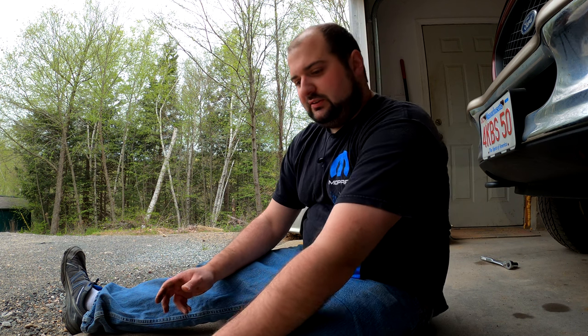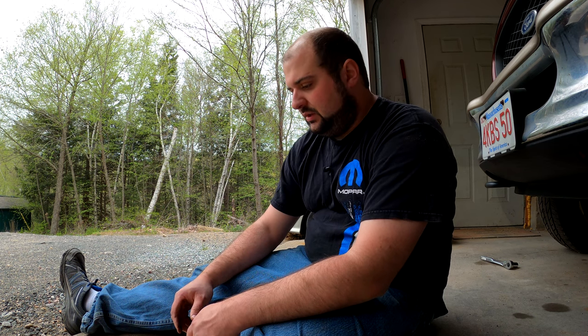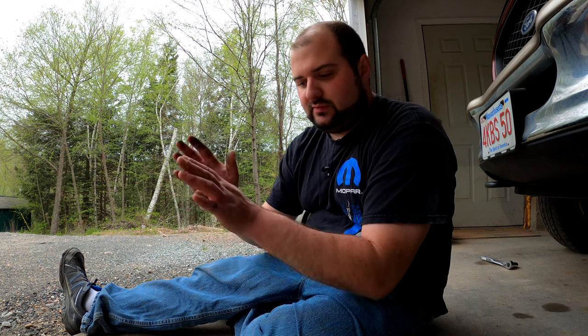When you buy a vehicle like this that's low mileage and has sat for a while, you're going to find that things like your bushings, your joints, that sort of thing — greases have dried out, rubber has dried out, things get cracked and brittle. You end up having to go through it even though it's got low mileage. This is one of the last pieces — this and the pitman arm. The gearbox is fine, it's not leaking or anything I'm aware of, so we're going to reuse that. Hopefully I don't have to pull it in this job. So let's move over to the pitman arm.